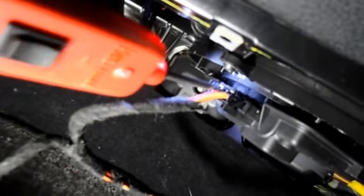To take the motor down, you want to just push these clips in on the side right here and unplug the electrical connector. You can just squeeze these together, and it pulls right out. The same thing on this side over here. You may need a screwdriver or something to push on it to get it out. Sorry about putting that down, but I couldn't unplug this without two hands. You just push that little clip in on the side right here, and it pulls right out.